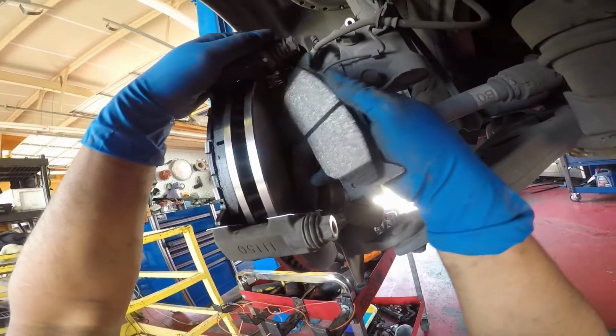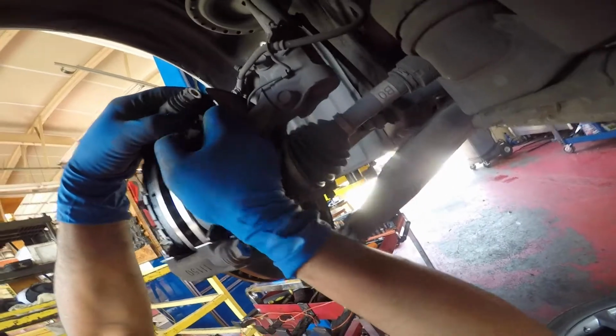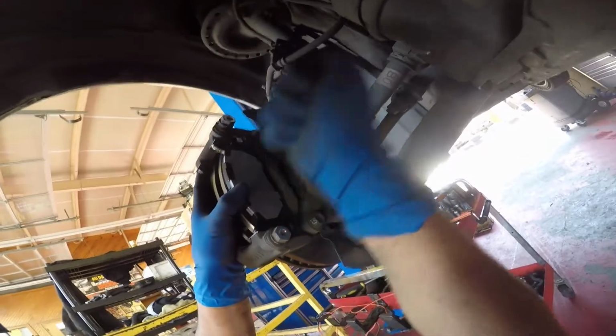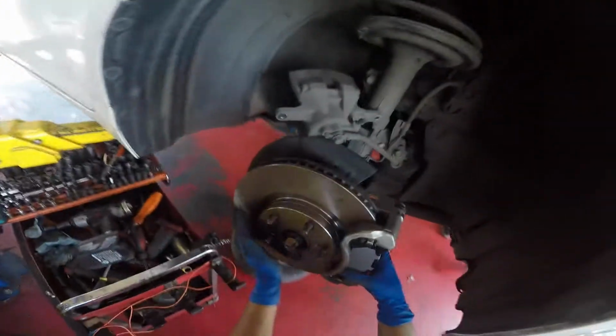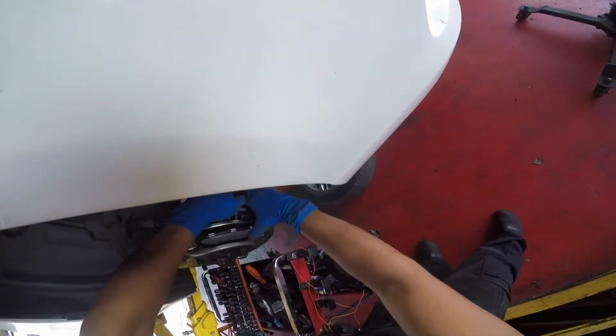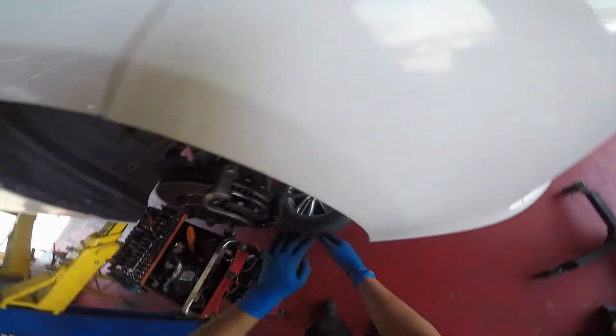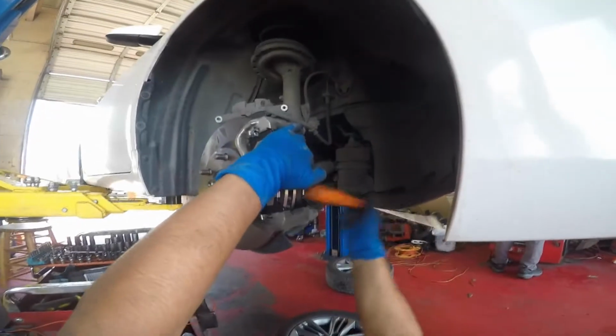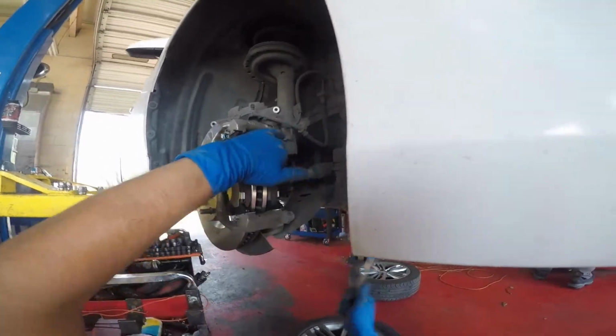And this two right here, installing the brake pads. The front one is easy. The other one, you got to get a really good view of it to get that sensor in right. And I was not having it. It just wasn't fitting. I was fighting that side quite a bit. You see me pull out a screwdriver and try to bang it in place, but it wasn't catching on that bottom side. It wasn't sliding in all the way. So there I am trying to smack it in place.